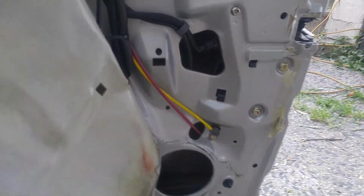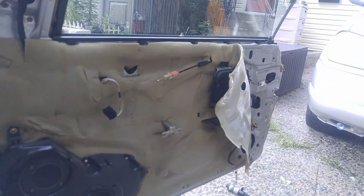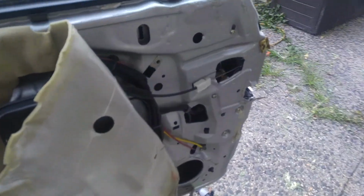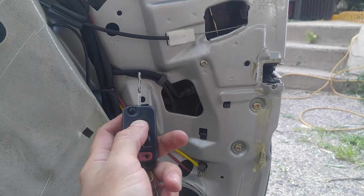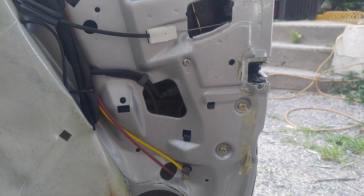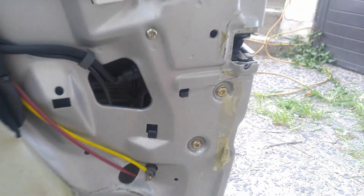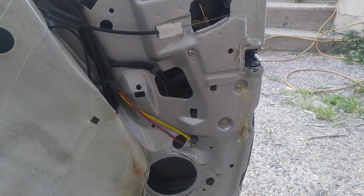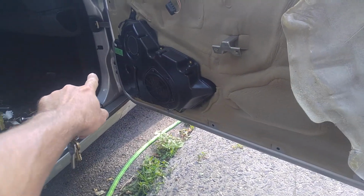As a matter of fact, let me show it real quick. When the door is open, I can actually show. You can clearly hear it hiss. So let's do lock. We'll lock it. It's all fine. So let's unlock it. Okay, so you heard that hiss, so it's coming from here. The soft close didn't work because the leak was there in that area.